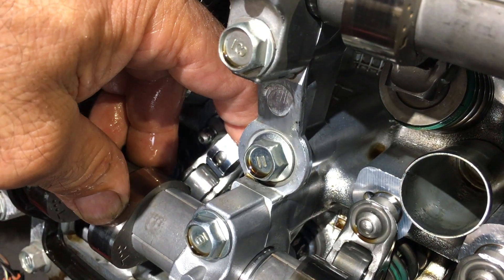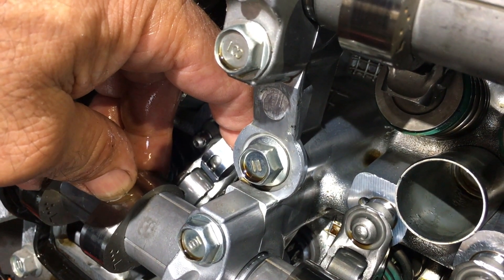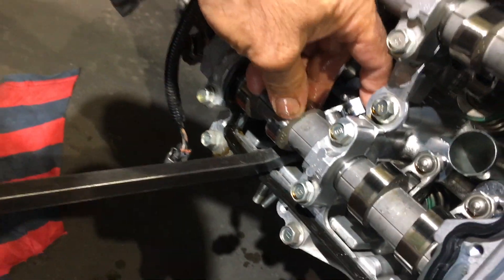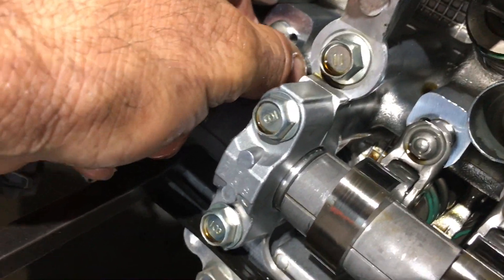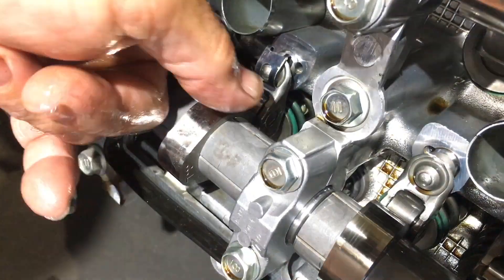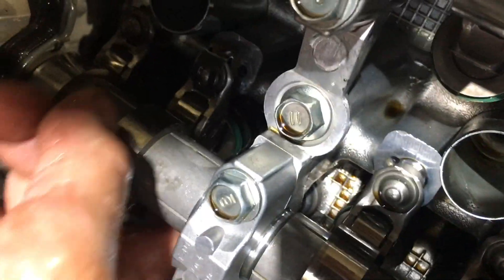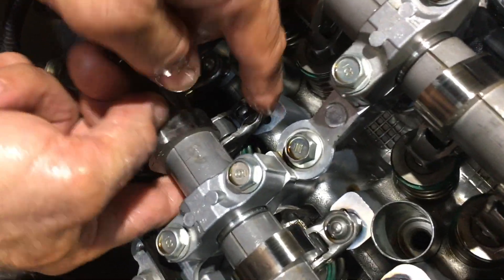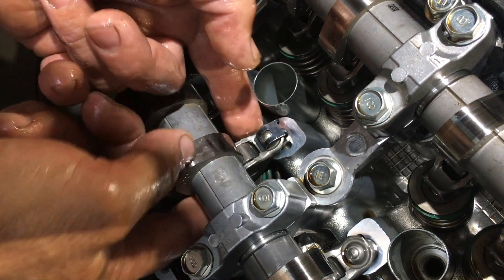Keeping a little bit of load on it towards the camshaft lobe, push that valve spring down again — having this pry bar underneath it will stop it from dropping down as we push the spring down. Push the spring down and slide the rocker over onto the pivot, just like so. You'll hear a click, and that neatly locks the rocker onto the pivot. Make sure that the little bucket hasn't come away off the bottom of the rocker that sits on top of the valve stem. It's nice and free, with plenty of clearance.